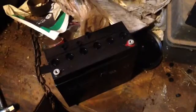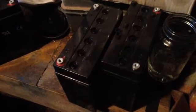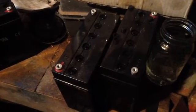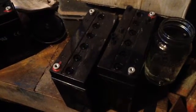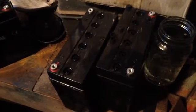I started tinkering with them, took all the caps off, and of course they were bone dry. So I filled them all up with water and kept charging. It got to a point where the NOCO Genius just sat at 25% charging forever. I think these batteries were well past their life cycle — past their expiry date. They were probably charged dry a few times, which completely wrecked them, so they wouldn't be recoverable anyways. I guess I can't fault the NOCO Genius G3500 for that, since they only claim to improve the performance of slightly sulfated batteries, and these would probably not be considered slightly sulfated.